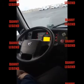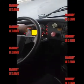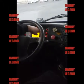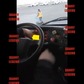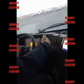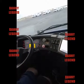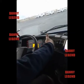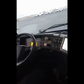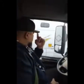I get an indication — it says 'stop, low system air pressure' and primary and secondary are blown up red. That tells me I lost air — there's my 60. Now continuing to 40 and 20 — sometimes they pop up together. I'm gonna continue to pump my brakes and watch here. There it is. And there's your in-cab tug test and brake test — I just passed. Now I'm gonna go do my shifting.